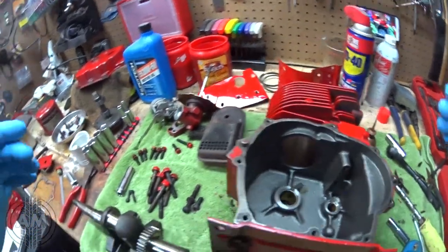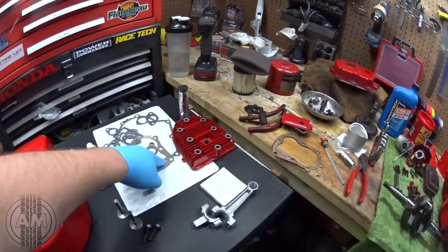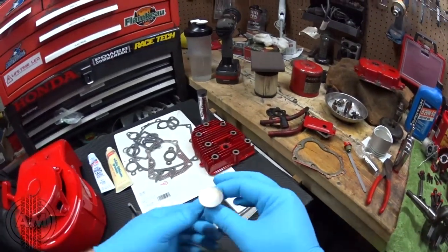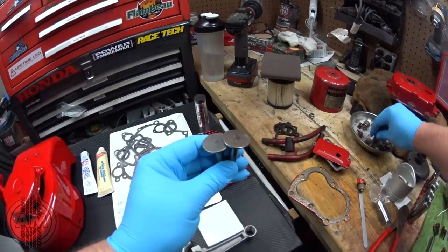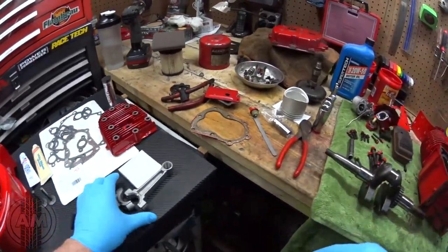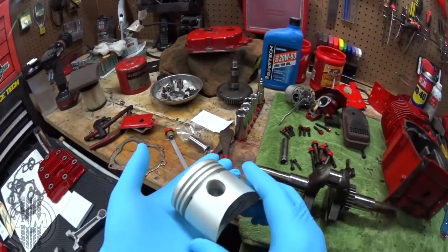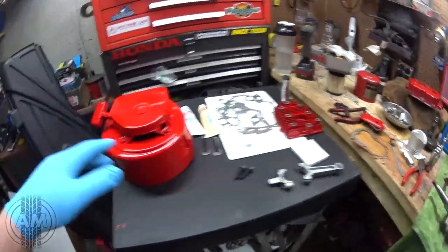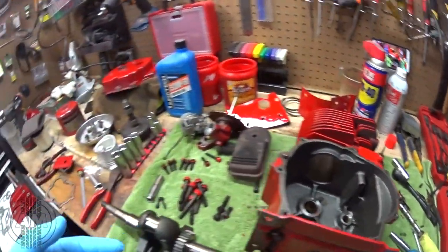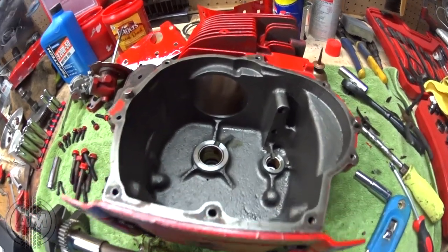One eternity later. It's about a week later and I finally got some parts in: a full gasket kit, a new head gasket, the correct air filter with the oil sponge, and new tappets that are not scored up. The original exhaust tappet looks pretty bad. So we're going to be using the new ones — and actually they're used. Also a new connecting rod, new rings, new piston, new wrist pin — all the goodies. I had some time this week and put a nice coat of paint on the main body. Not going to do the tank or the air filter until everything's back together and I'm sure everything's working well. Let's put this thing back together.